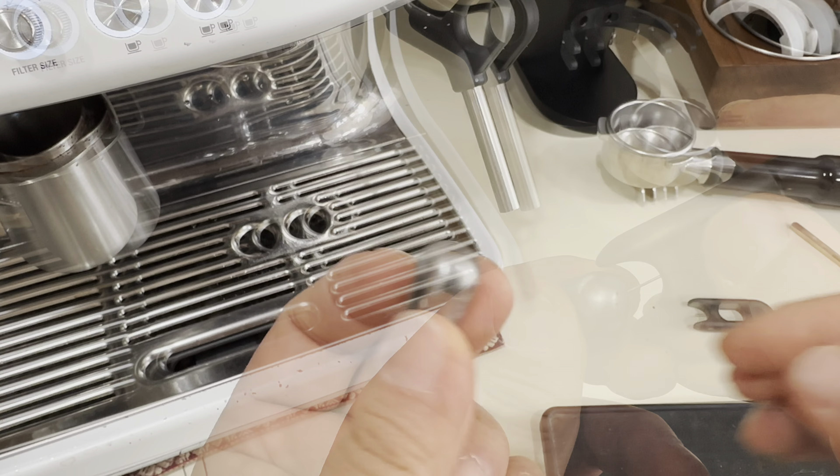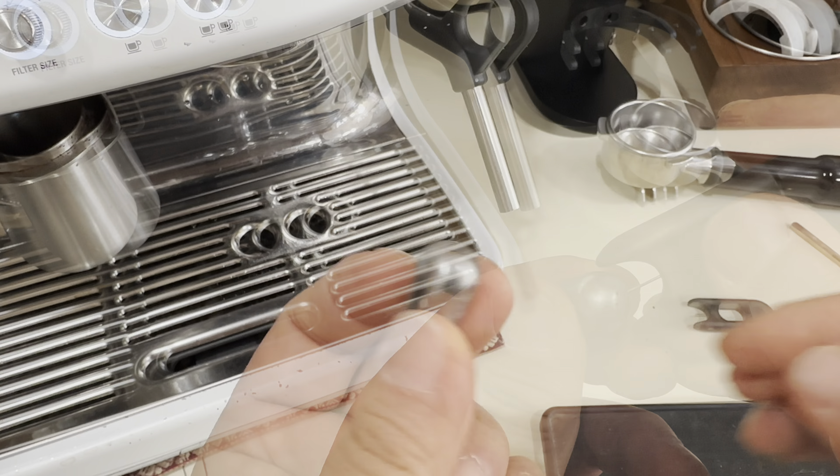Let's work on the steam wand tip. Obviously you can't use your hand. At the back of your tray there are two parts — simply go in and twist it counterclockwise and it comes off. On this device you're going to see a sharp needle with the steam wand. You'll see four holes — just clean them one by one. Once cleaning is done, simply put it back in and twist it clockwise. Do not go too tight.